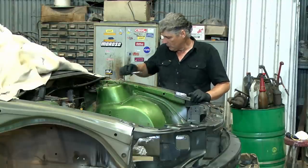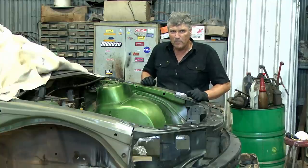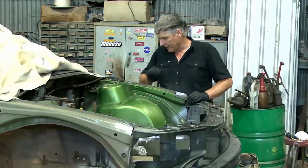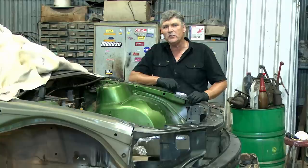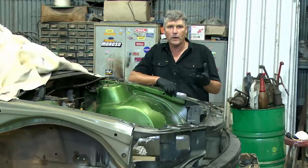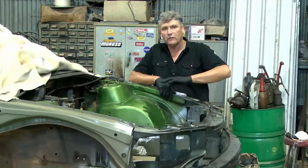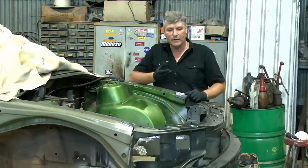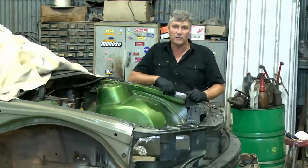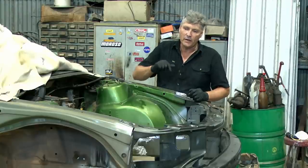So we'll get into it with a good wax and grease remover. And there's a couple of different ideas floating around out there. Traditionally, we would use two rags. So you start with a wet rag, which you put your wax and grease remover on, and you give it all a good rub to loosen up any impurities, contaminants, and things like that on the surface. And then you come along with another rag and you dry the area.